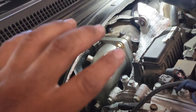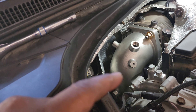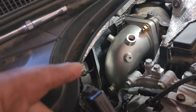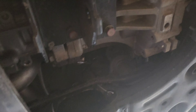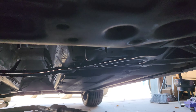Alright guys, so I snaked it up through the bottom. Now it's time to put your bolts down here and your mid-section of the cat-back exhaust. Put your O2 sensor here, and put your gasket on the bottom over there in the mid-section — don't forget that. Get it bundled up. Make sure you put the motor mount here.